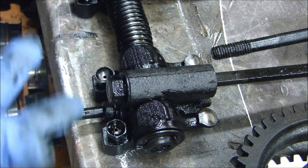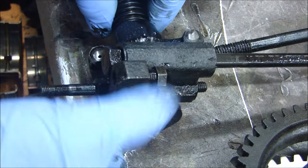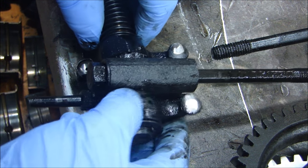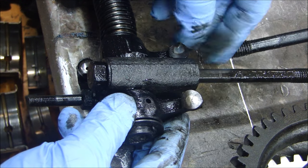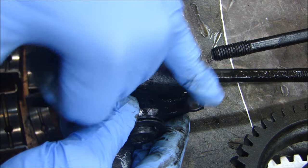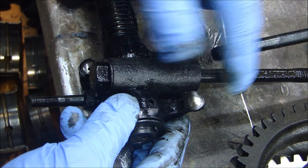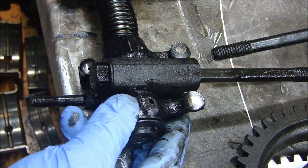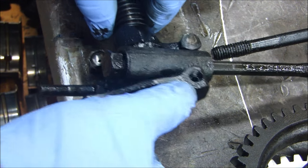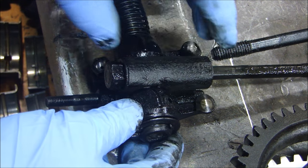The next thing I want to do is start to collect my small parts. The small parts are like the rocker arms on this rail here. I'm going to take these apart — pull out the screw for the adjustment, take them all apart and clean them. You can see that since I'm changing the valves and the heads, these rockers are kind of seated. You can see how they're worn from the valves that were in the engine. So we're going to clean this up, machine the surface to clean up these rocker arms so that when they sit on the new valves, they sit properly — that way setting the lash will be easier.